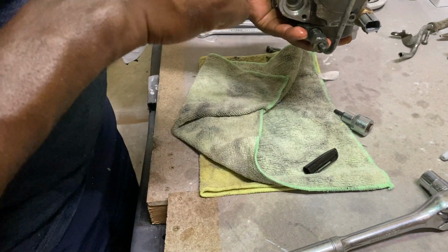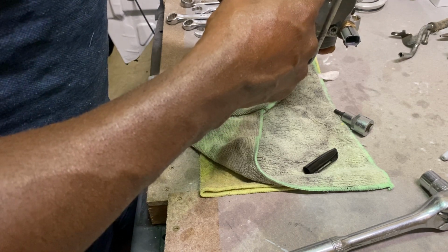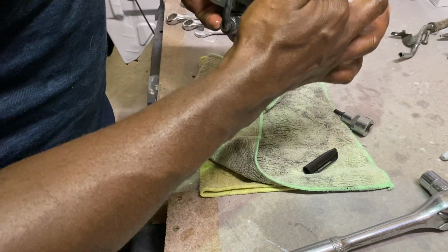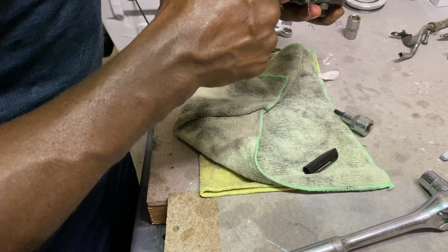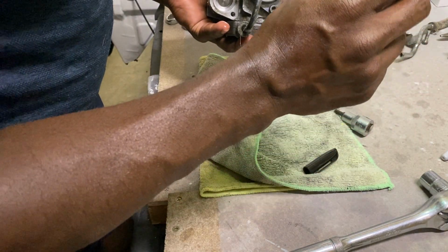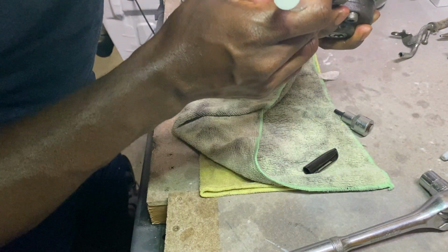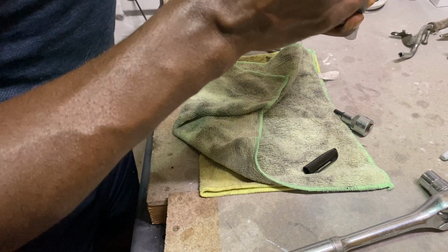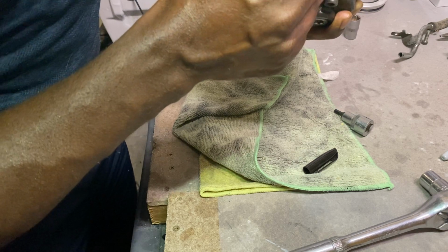Diesel comes through that one. Yeah, diesel comes through that. Goes into the filter. So the diesel comes in there, goes here, gets clean, gets into this pump. Gets pressurized with this pump, and there's a little hole there, the one on the bottom. So the diesel comes through there to the filter, to the pump, and then it goes to that hole on the very bottom.